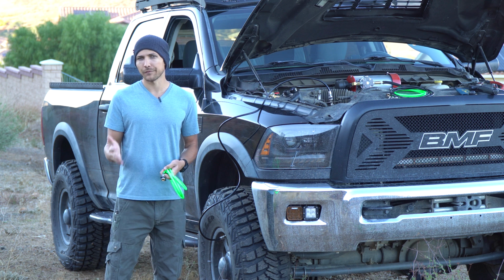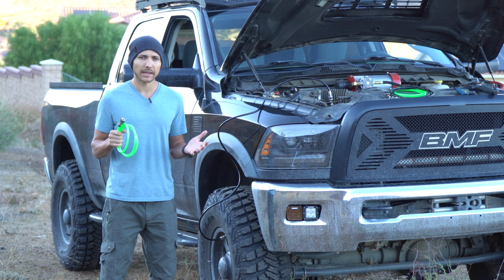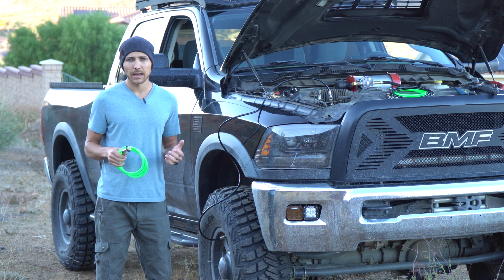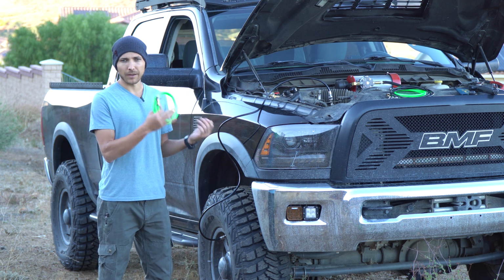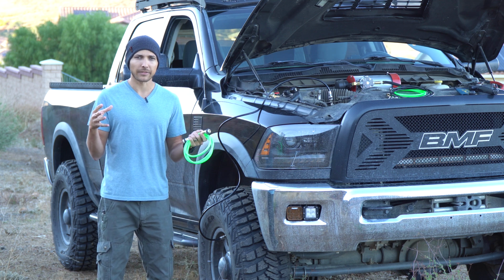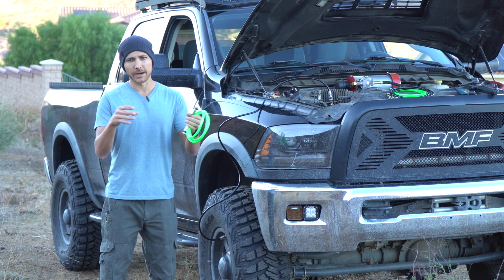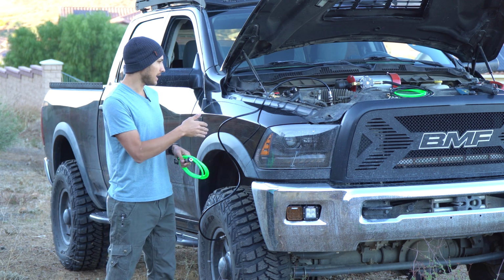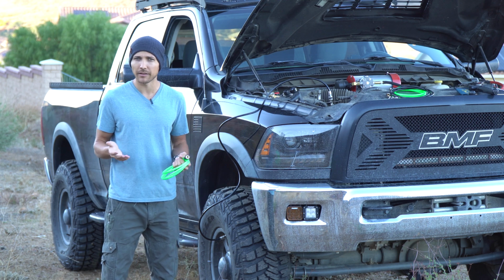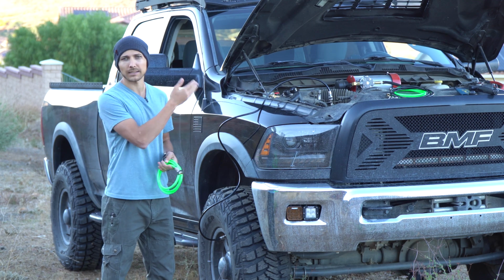Now, when you're doing that and you're filling up your tires, they're not actually filling up evenly. Now, I know it's going to be off by a little bit here and there, a couple PSI, but it's been off as much as 6 PSI between the different tires. And so that's annoying when I fill up all the tires and I'm driving down the road, and by the time the TPMS sensors figure out the actual pressure in the tires, my pressures are all over, and it's not like the front is one pressure and the back is different. Like the front right will be lower than the front left, and then the rear tires will be off by at least 3 or 4 PSI from each other. And then the largest discrepancy in pressure I've had is about 6 PSI between one of the front tires and one of the rear tires.